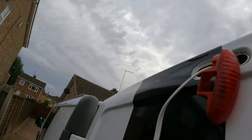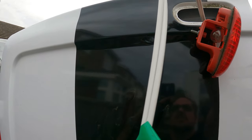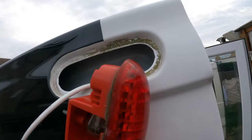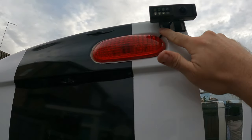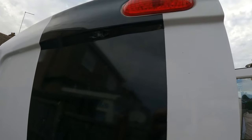The second issue is where I'm going to put the actual camera itself. I think the best point on a van with no rear view at all is at the very top so you can see all of the road and everything behind the van. So I've just removed this light to see what's behind it. I've fed the cable down into the door to see where it comes out, and I've got it coming out here — that's probably where I'm going to put the camera. The camera is basically just stuck onto the metal using the 3M adhesive that came with it and it is really sturdy. We can always screw it in later if we need to. It goes behind the centre brake light, down inside the door, until it gets down here.